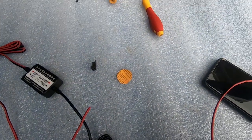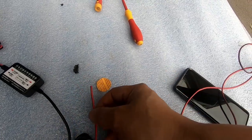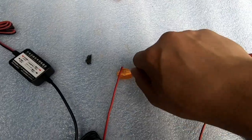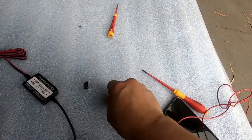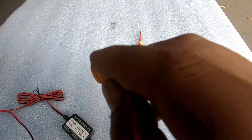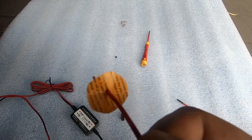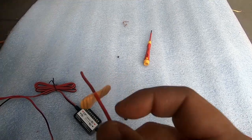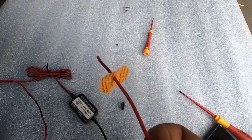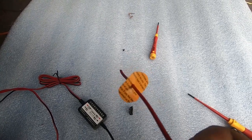Let's imagine for a second that this is the rubber grommet and this is your power cable that has to go through it. Do not take it off completely. What you want to do is pierce a hole through it like so, and then push your cabling through. Pretend this yellow piece of paper is your rubber grommet — you want to pierce it just enough so that when you push the cable through, it's completely airtight still. Do not make the hole too big where the cable can freely run in and out, because you want it to be airtight.